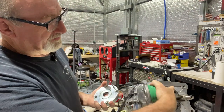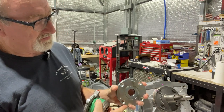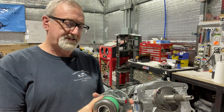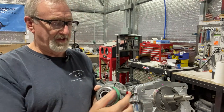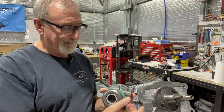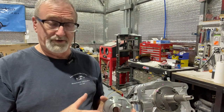Now in this application, you can see how the bolt holes are on the transmission. This retainer ring goes in like this, and we're going to clock it so that the throw-out bearing is in this direction so that our hydraulic fluid line comes in from the driver's side. There are also a couple of spacers that go in front of this, just in case we need those.